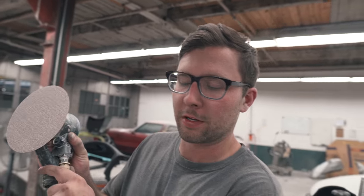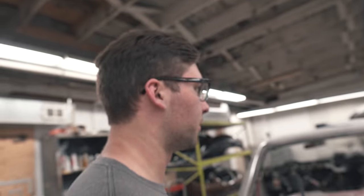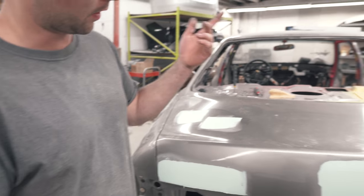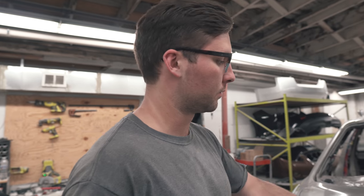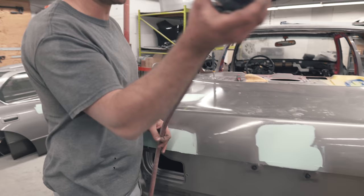Thirteen and a half hours. We're back from our food break — we waited way too long for this to dry so now we've got to sand it like normal. I'm going to hit it with 80 grit first, then probably 120. People say finish it with 180, but you just don't use enough primer — or your painter's an asshole. So we're just going to knock this down and then that'll be it. This is actually only the second coat — first coat for a lot of these.